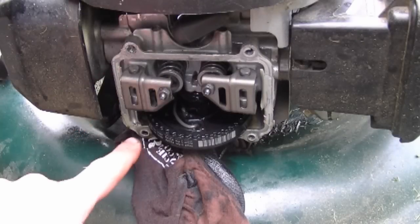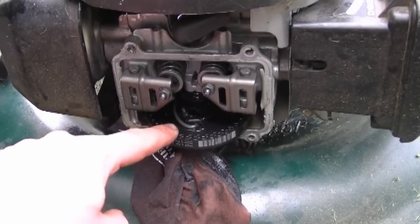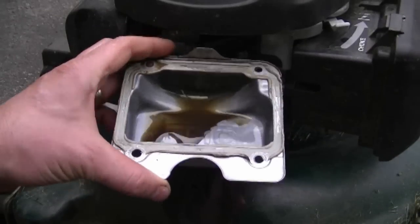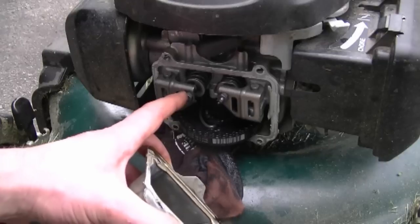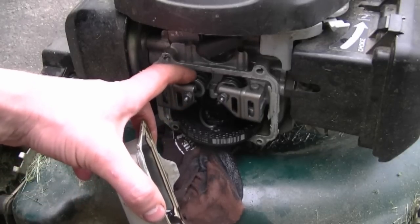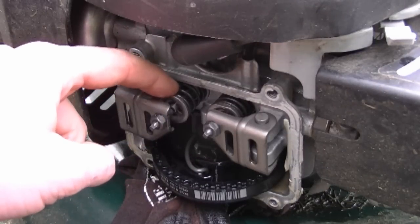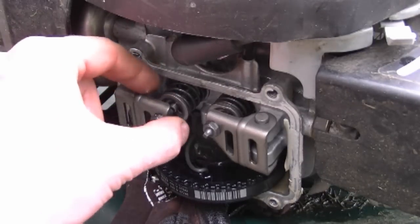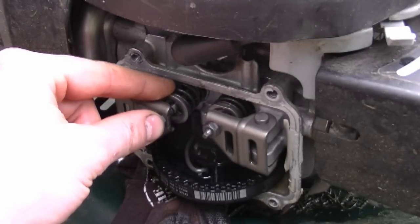Here's the engine with the cover off. It's an overhead cam, that's why you see a timing belt and the cam gear right here. In this case, because the cover is dented like that, the valve lifters cannot properly come back to let the valves shut tight. Because of this, a bit of air escapes out of the valves through the head, because it's not making a tight seal inside the engine. So basically, the valves are always open.